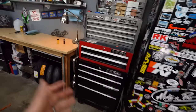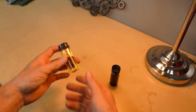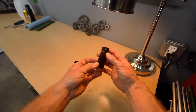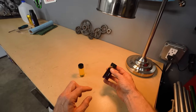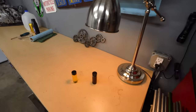For reference, I've got some brake fluid samples here. The vial on the left has clear, fresh, bright yellow fluid — that is what you want. And the vial on the right is the old gross stuff. It gets dark, it actually gets sediments in it. This is not what you want in your system, which is why most manuals will recommend replacing your brake fluid every two years.